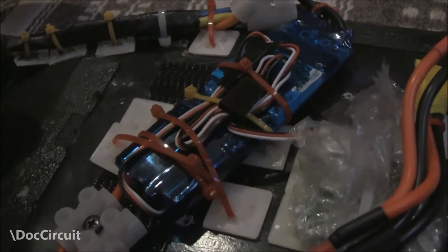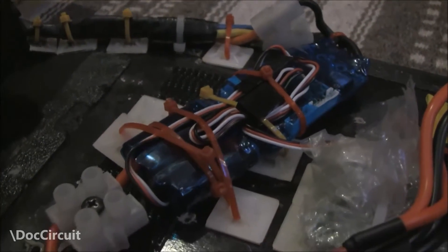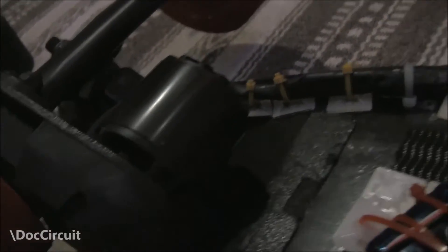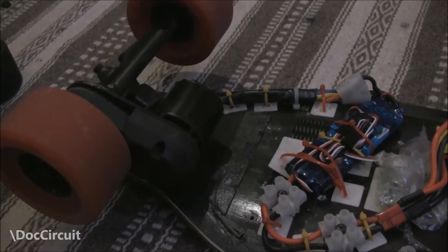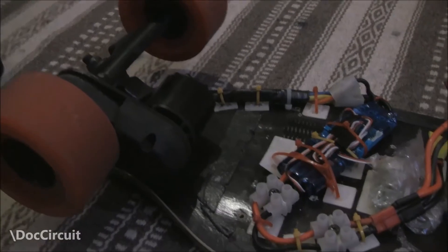So I thought I'd try fitting the VESC, which I've set the current to a 60-amp limit. I think you can also set the temperature on this but I've not fired up the software for a while. And that did work. I've been using it in this configuration for a week, and the motor at its worst gets warmish, and the FETs — I'm touching all the time when I'm testing — get only slightly warm. That's shifting 16 stone of weight over hills, going over the same hill repeatedly stressing this, and it handled it admirably with no problems.